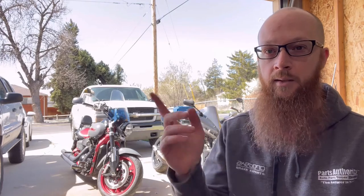So I do still have the exhaust manifold, which I've soaked the bolts in PB Blast, a kind of penetrating catalyst. I've been spraying them so that they could soak and hopefully get as little breakage as possible. I'm hoping to not break any, but as I was inspecting it, it actually looks like there are already two broken bolts there on the very far back by the firewall on both sides. It looks like the bolts are broken.